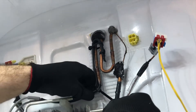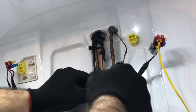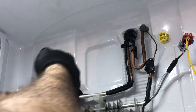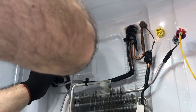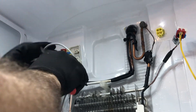Other techs have also been doing this successfully. As you can see, I zip tie the heater onto the suction line here. I'll link the special zip ties — they make extreme weather zip ties rated up to 250 degrees, and those are the ones I recommend.